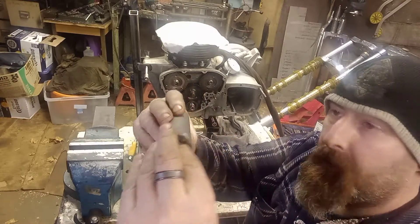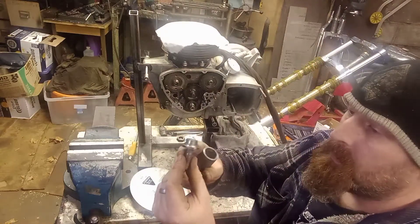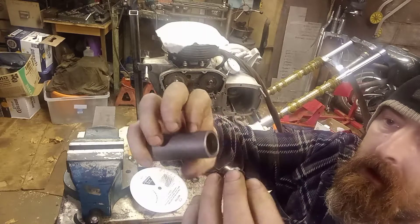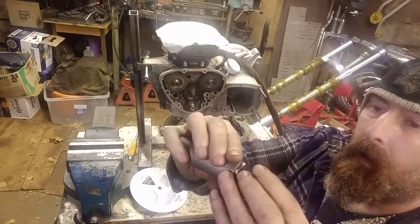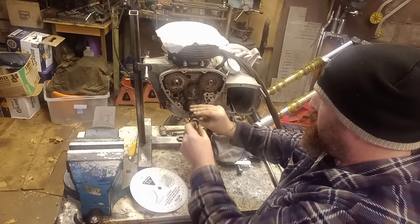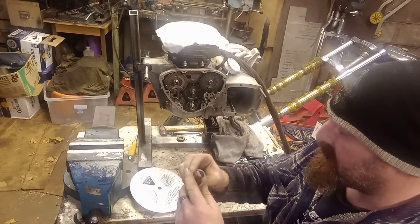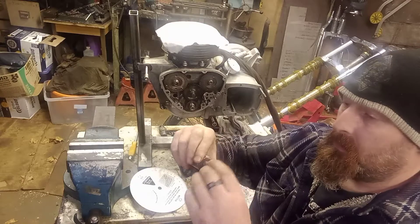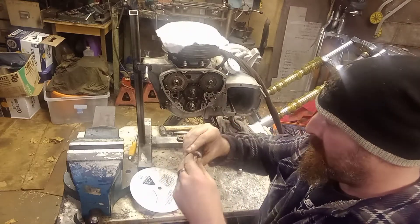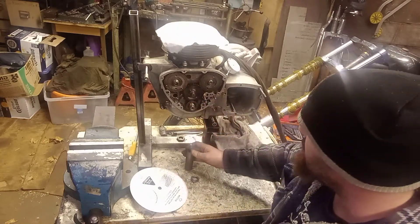After I've given it a bit of welly with a hammer in the vise, on the other end I've got the old alternator nut, which I've machined a little shoulder on where the hex would be — halfway down the hex — which will go on the other end. I'll press that in, that'll keep it all straight, and the whole lot will go on the end. I'll just tack it all together — I won't weld it all the way round, just put a couple of tacks on, because I don't want the alternator stud to not be able to thread in there if it's distorted by the welding. It doesn't need to be strong, it's just got to stick on, so when I put a spanner on the crank, the timing wheel turns round on this side — it'll make the whole lot easier to see.